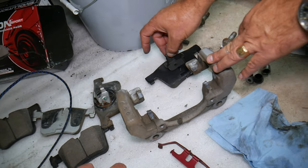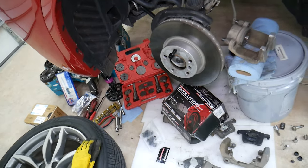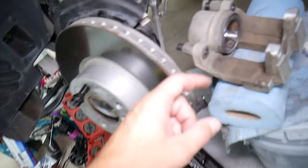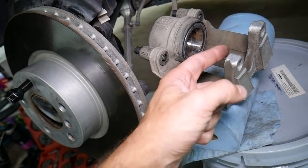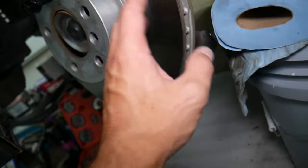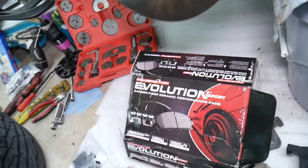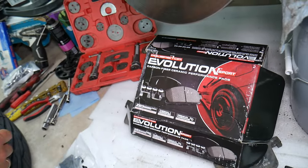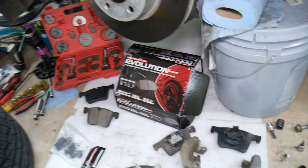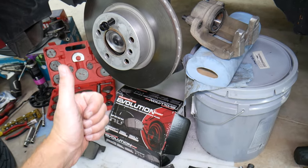That's how you grease brake pads. You just put everything back together in reverse order. You need to apply grease to all the contacting points — piston to brake pad and the bracket contacting points. Never apply any grease on the brake surface itself or the rotor, because if you do, your brakes will have seriously reduced performance. We will have a special video about how to seat new brake pads and how to break them in — check it out on the channel. Hopefully this video was helpful. Thank you for watching, see you guys next time.